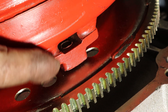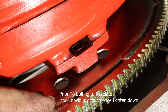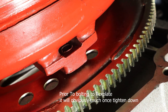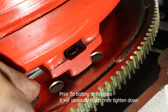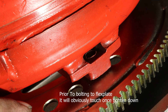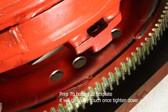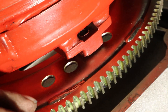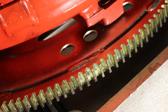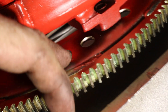With that gap in range, we do not have to use any shimming washers. If you have more than 3/16" of a gap, you would then shim to at least bring it within that range. If you have less than 3/16" you don't need to shim, but if it's actually touching, the converter might not be seated all the way — there are many possible reasons. You want an air gap. If it's touching, figure out why — maybe it's not bolted all the way down and something is preventing it from seating. So we're going to go ahead and bolt this down because the gap looks good.